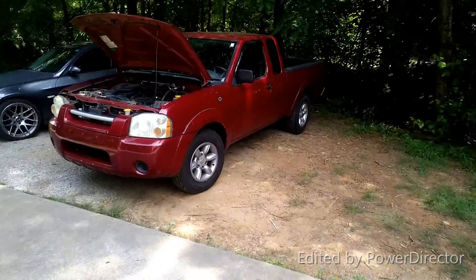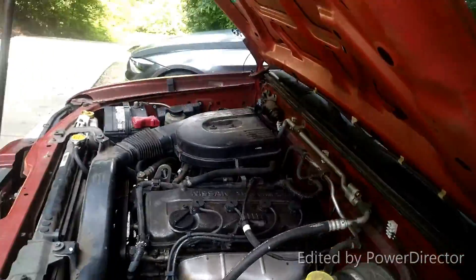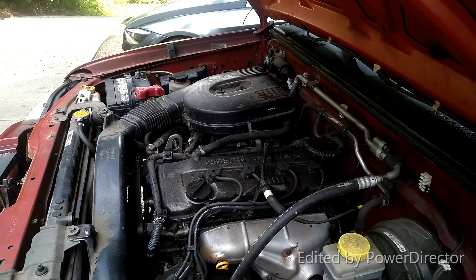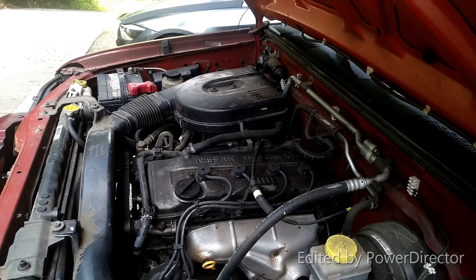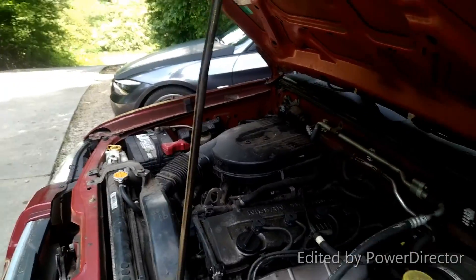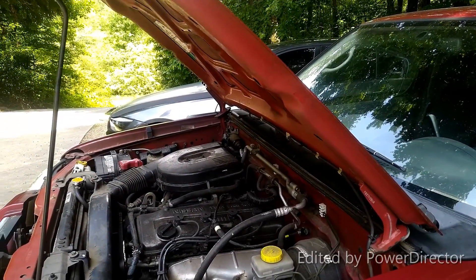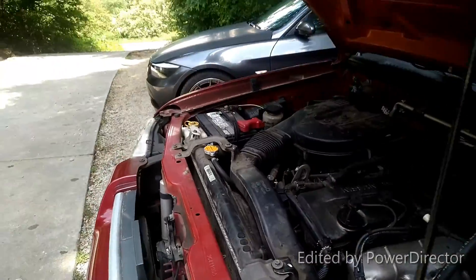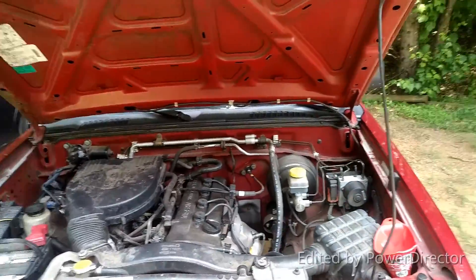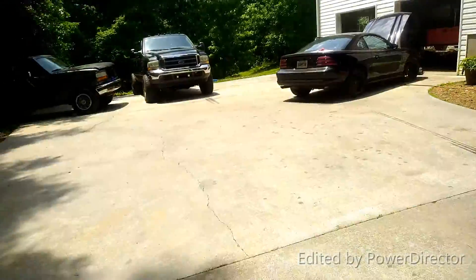A customer just dropped this off with me for the weekend. He said he had a little scan tool of his own — had a cylinder one misfire and a screechy belt during startup. He also said he had some kind of EGR code. I have not scanned this vehicle or looked it over much at all — you can see it needs a valve cover gasket pretty good. I think the EGR might be doing something funny because he said he did a tune up and it's still running rough, so we're going to go off his direction towards the EGR but also be looking elsewhere in the meantime.